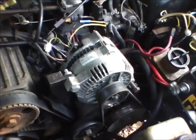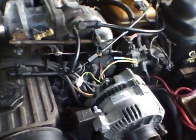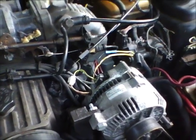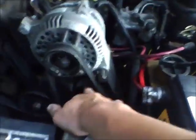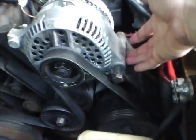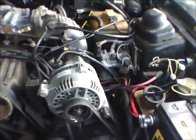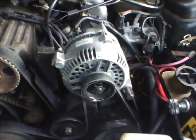I'm going to put links in the description to articles that helped me through this installation process, which will also help you, and they include wiring diagrams to further explain how these wires are laid out. You may also have to take a grinding wheel to grind down the metal casing a little bit, because on the bottom where it mounts into the bracket, it was contacting with the bracket and wouldn't sit all the way down. I had to grind off part of the metal casing, but from the front it doesn't even look like an aftermarket part — it's still a stock Ford part, just not the stock part that came out of this car.